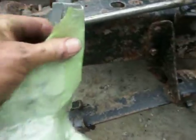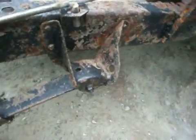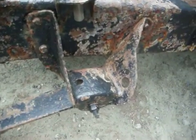I was telling you guys about making patterns — this is a pattern for the spring hanger, the front ones. There's the spring hanger and there's my pattern. These back pieces have to be folded back and they lay against the frame. What's nice about these patterns is that you can trim them, use them to make shapes — it just makes life a lot easier to have something like this that can move around rather than trying to measure everything out. I'll probably use two pieces of steel to make this piece.